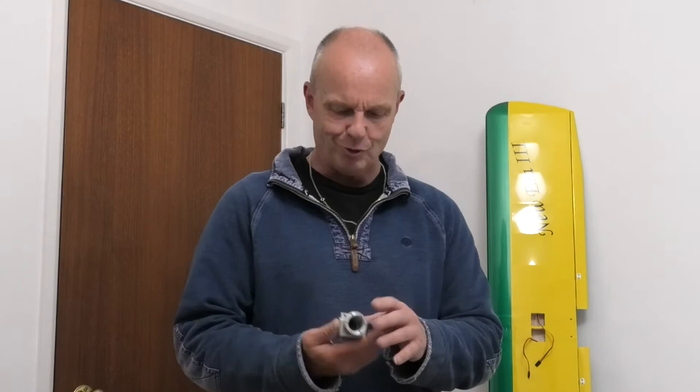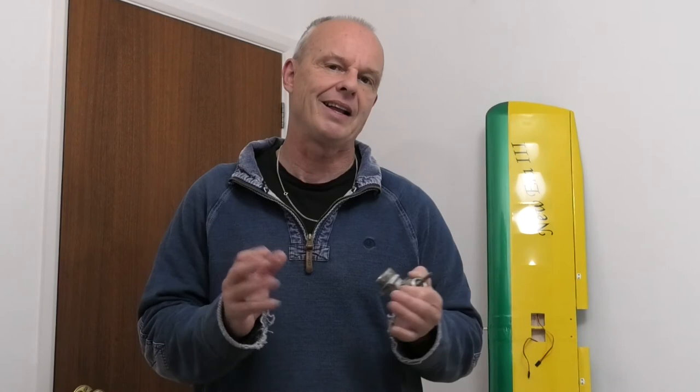The engine's cooled down nicely and it's rotating lovely. I can't wait to get it built up and on the test stand — these Irvines run really, really nice. Hopefully this video has shown you how easy it can be to take your bearings out and put new ones back in. It can vary a little if your bearings are rusty but the trick is to get the crankcase hot and uniformly hot so that it expands enough that the bearings just drop in and out.